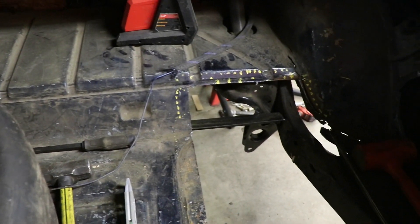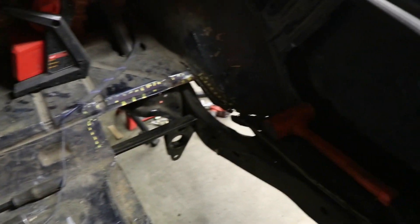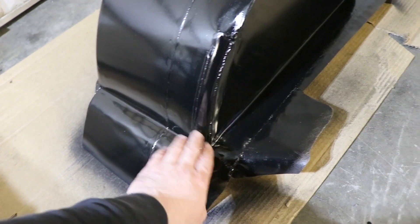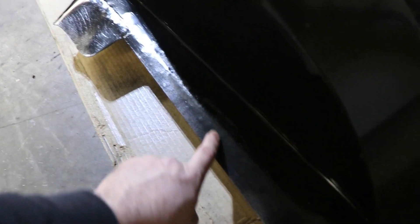Where the yellow dots are is where I intend to have it all match up again, so I'll have to grind away the paint to have something good to weld to, and then figure out how to reattach the sides here. The layers are separating and I'm going to have to get all that tacked back together - that was about the only thing solid left of the original floor, which has already been cut and repaired multiple times before. I ended up having to narrow up this wheel well area and put patches in different places to cover up rusted-out sections.